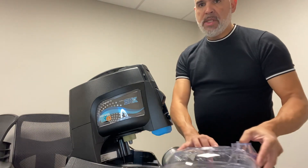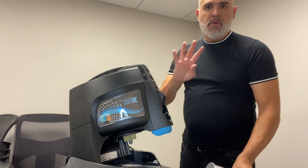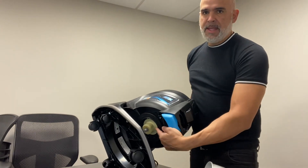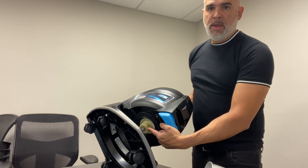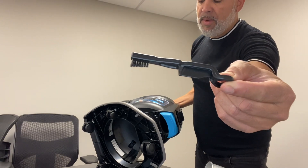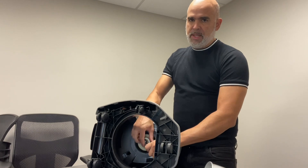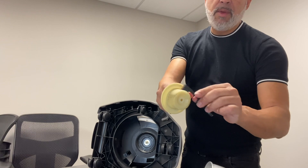Number two is once per month, every four weeks, or every four uses. Just turn it on the side like this — see that part right there? That's called the separator, and what it does is separate the air from the water and the water from the motor. With one finger, just pull the wrench out — it's a wrench and also a brush. Take the nut off — it's holding the separator together — and then brush it out with water and soap to make it all new.